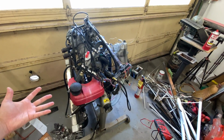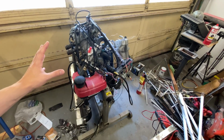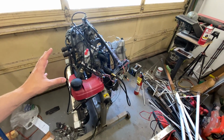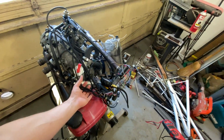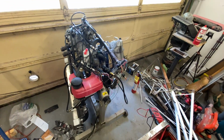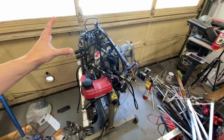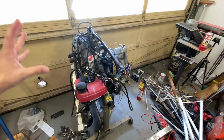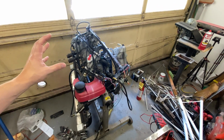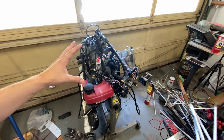The purpose of that being, we're going to run this for a little bit longer. Now, it's run for a brief second before with the wiring mess we had, and for that matter, I've even done a quick test start just to test the hookup on this, though I'm going to film my extended runs later. So what we're going to be doing now that we have done our initial testing to make sure it runs is we're actually going to be scoping a couple of outputs and just checking to make sure that some limp modes and some other things are defeated on here.